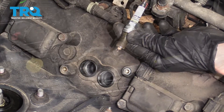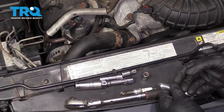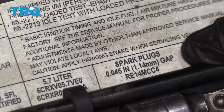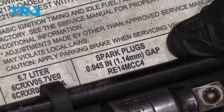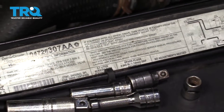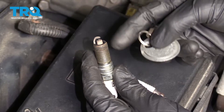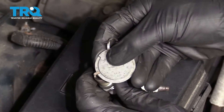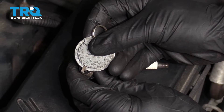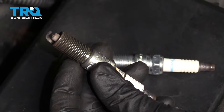There it is, friends. When it comes time to checking or replacing your spark plugs, you want to make sure you have the right gap. Look for something that says spark plugs with a number and the gap — that tells you where it should be. You can find that inside your engine compartment or in your owner's manual. I always like to check the original gap on the old plugs. I'm going to use my gapper and take a peek. This vehicle is supposed to be at 0.045, and as you can tell, it's well over that — the spark plug needs to be replaced.